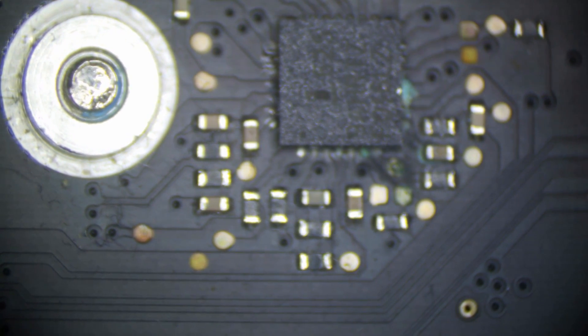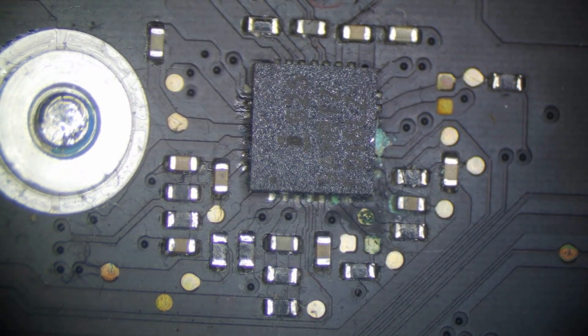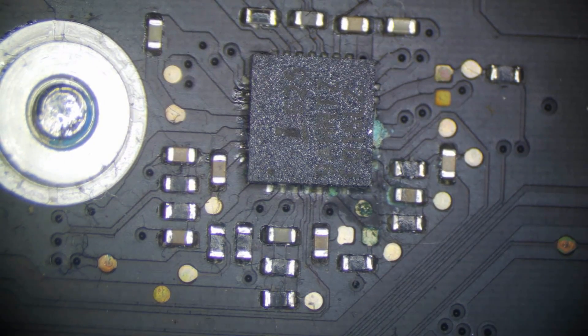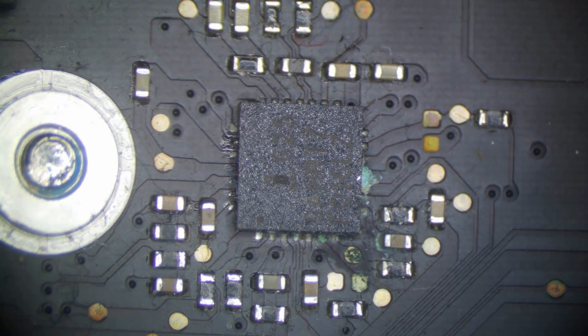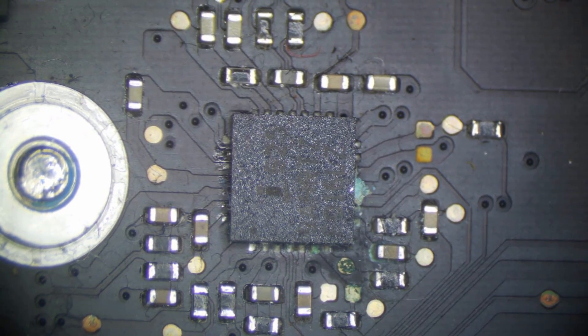Another thing that could kill a battery is if PP bus was 16 volts when it should be 12 volts — that happens quite a bit on this board. We could replace the MOSFETs as well if we think they're bad. What I'm going to do is plug this in and see what voltage I'm getting on PP bus G3 hot. If it's 16 volts, we'll replace the ISL and the MOSFETs. This DCM board looks really bad, so I'm not expecting anything good.